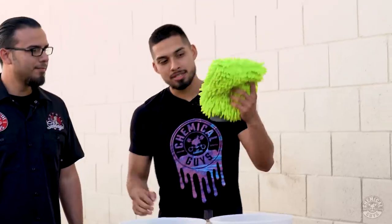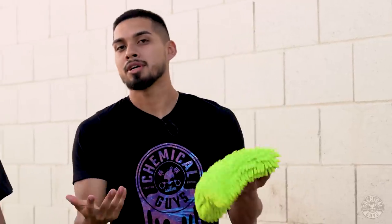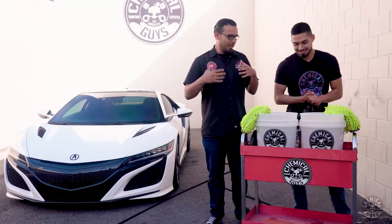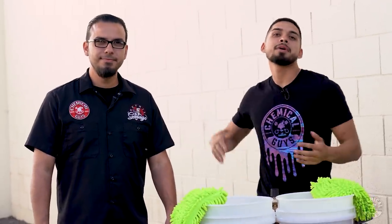We will also be having our chenille wash mitts. The reason why I love chenille wash mitts is because they have these cool noodles that are going to trap all the dirt, keep them from spreading out onto the car, especially when I dip my wash mitt into the dirt trap — it's going to help release them a little bit better. We've chosen to get two brand new wash mitts, as well as two new buckets and two new dirt traps, because this is a very expensive brand new vehicle. We're taking the precaution by giving it a thick lather of foam, which is going to help emulsify the abrasive particles of dirt, and with brand new wash mitts we're not running the chances of cross-contaminating with something we've used on another vehicle. We're going to rinse off the vehicle first to knock down any loose grime and debris, then foam it up, then scrub it.